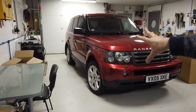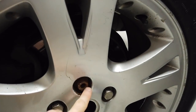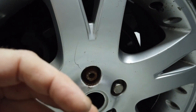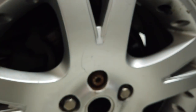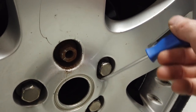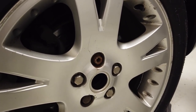Our first problem was undoing the wheel nuts - some of them have these little foil caps over them and they were just spinning. In the end we had to get the cap off. It's a stainless cap that reveals the nut, but the cap had detached from the main nut. Because it's hollow in the middle you can pierce a hole in the front and work your screwdriver around - a bit of a wolverine job. I'll have to put some new wheel nuts on, but better to find it now than by the side of the road.